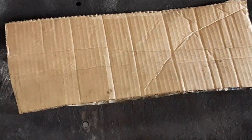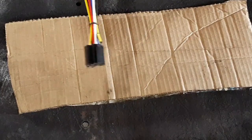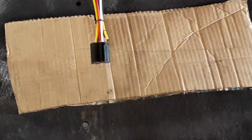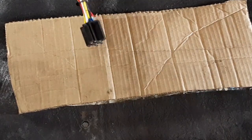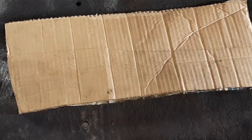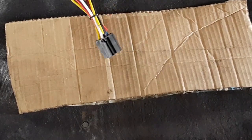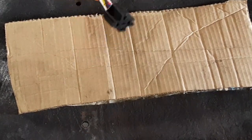Ready to wire up my torque converter clutch switch for the LS swapped S10. Basically, you need to supply power to pin 33 on the blue connector all the time, and when you hit your brakes, you need that power to cut off. Most brake switches just send power to the taillights when you hit the brakes. So a simple way to do it is with a relay.